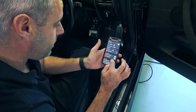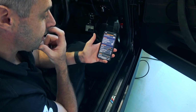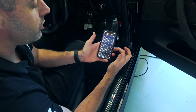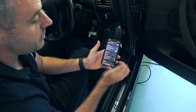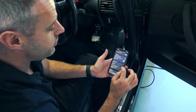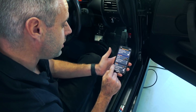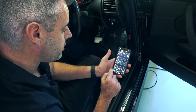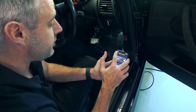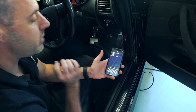We don't need to limit power, that's all good. It is a manual, so we don't need to worry about any of the transmission settings. These sort of settings here are for an aftermarket coil, an aftermarket T-map sensor if you're going to run higher boost levels. The ones that come in these cars should be good for about up to 20 PSI, so we're going to be safe with that for what we're running. Coolant target is stock. Don't need a wastegate rattle fix because everything's fine. Cool, so there's all the settings we're going to flash this time, and we'll flash the 2-minute flash right now.